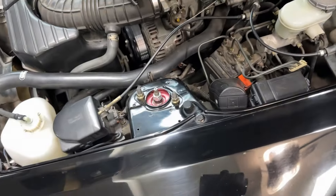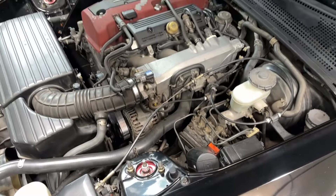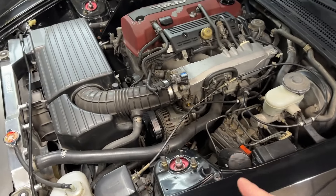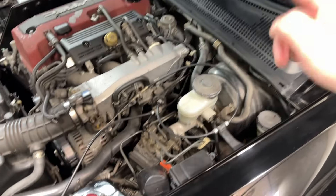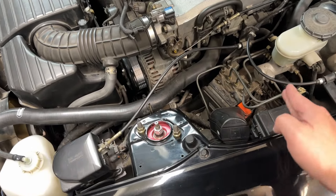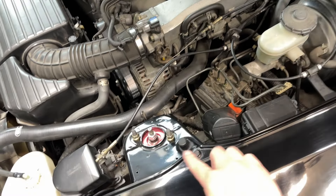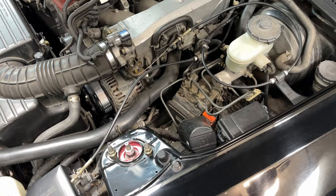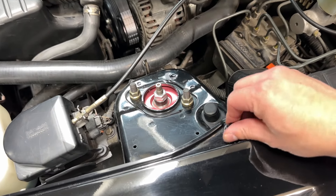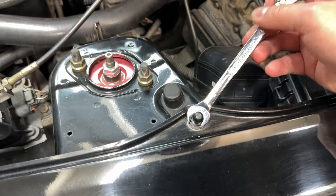For the S2000, you're going to be removing the bolt closest to the strut tower and the bolt at the topmost part of the hood hinge. It would be nice to have a friend help you hold the hood. Once you hook one end of the strut — I started on the hood side — you need to lift the hood up while putting the other end on, since the strut extends to about the stock prop position. I removed the 10mm bolt and I'm screwing in the stud along with the smaller washer — that's also a 10mm — then tighten with a 10mm wrench.